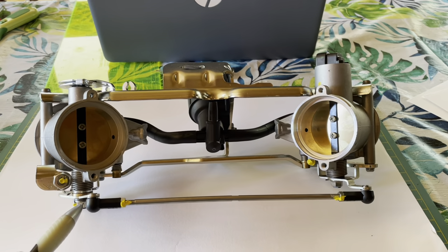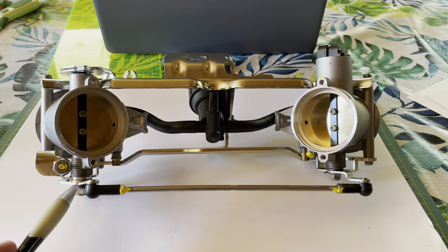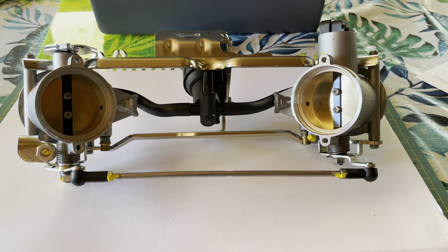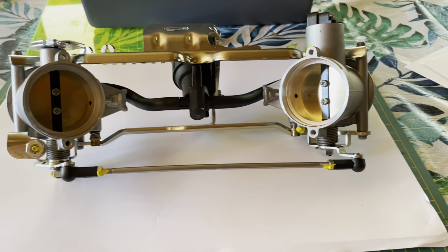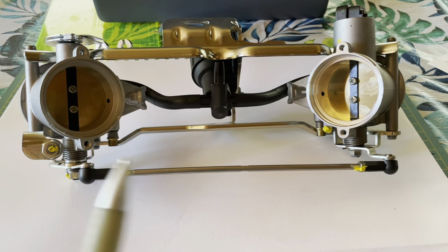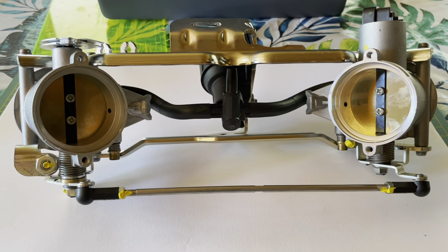You have a rod that passes down through the throttle body on which the left hand butterfly is positioned, and it goes down through to a device at the bottom which is the pivot, which incorporates a bell crank arrangement. That basically makes this linkage rod here adjust the same amount — it keeps the opening or closing of the throttle body plates equal when you are adjusting them for balance. If you were to just use a direct connection without the bell crank, you would find that one side would open more than the other as you adjusted the balance.